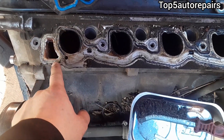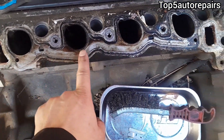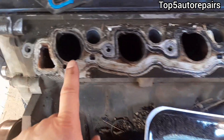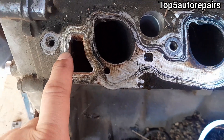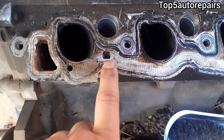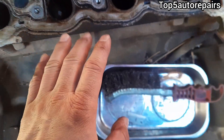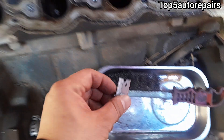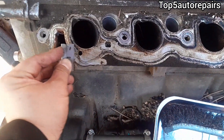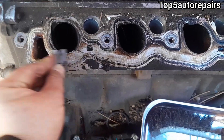The reason why your intake manifold gasket is still leaking after replacement is because the mating surface is not flat enough. For example, there could be a buildup of corrosion if coolant is flowing through the intake manifold gasket, the old gasket material may still be on it and you need to scrape it with a razor blade, or there could be a buildup of dirt on it and you need to wipe it away. My preferred method of removing old gasket material is using a razor blade.